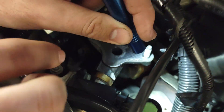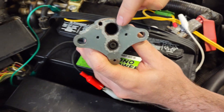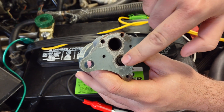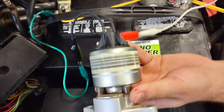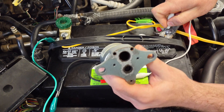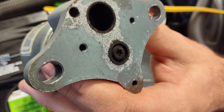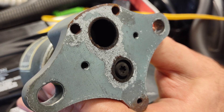Below it you can see our tube from the exhaust into the EGR. Here on the EGR you can see our big port which is our inlet from the exhaust, and this would be our little port which is our bypass into the intake. This is the electronic pulse width modulation — when I send power to it, it opens up that valve, letting exhaust into the intake. Closed means no exhaust in the intake.